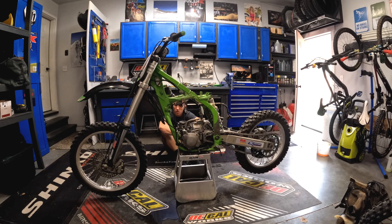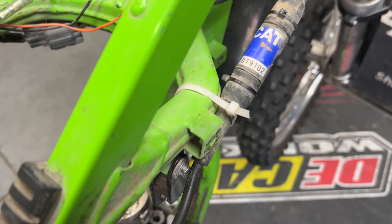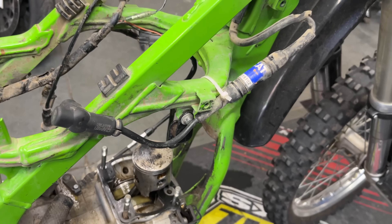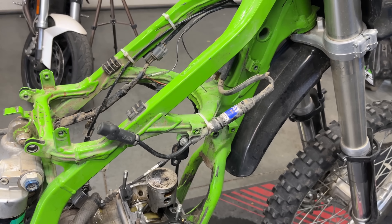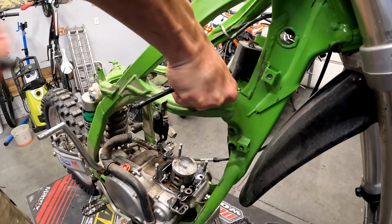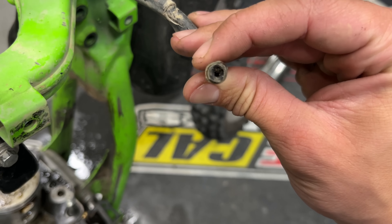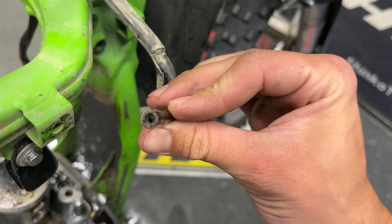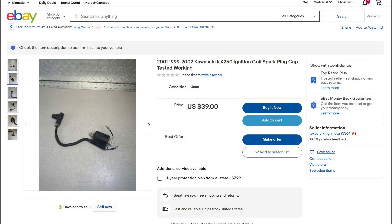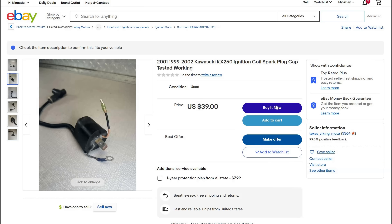I sat and pondered the best way to proceed, realizing that to make this a reliable motorcycle again I should probably pull the engine and split the cases. I also noticed some funny business with the ignition coil — I had no idea what this connector between the ignition and the plug cap was. That could certainly be the culprit for the weak spark. I pulled it apart to try to reconnect the cap with the ignition coil, but the wiring on the end of the coil had some damage and wouldn't accept the spark plug cap. So I found a used ignition on eBay for $39, and hopefully that will help.